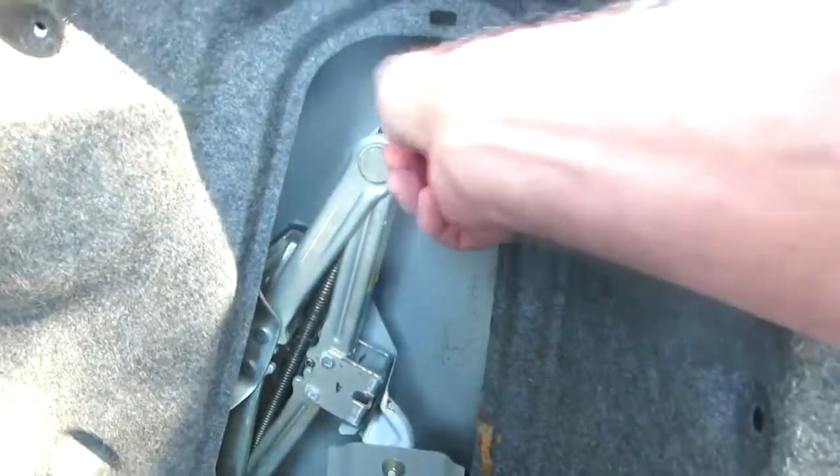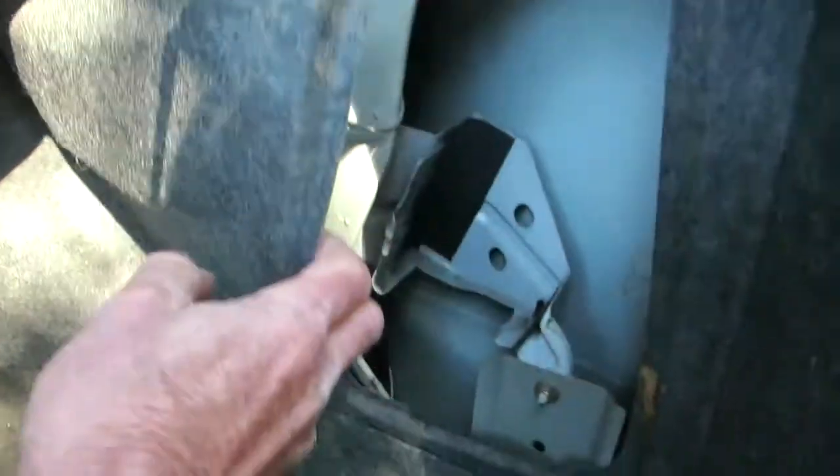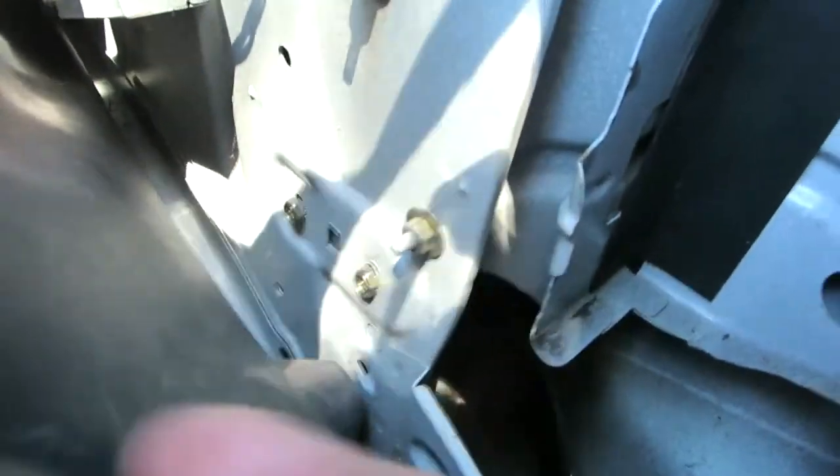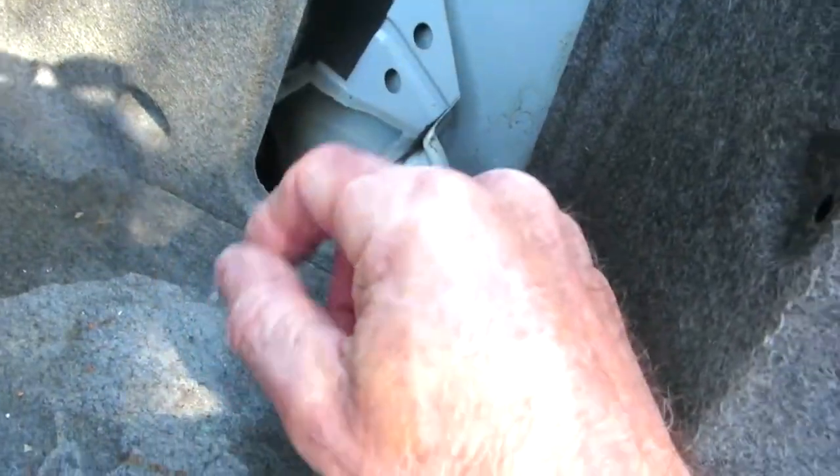You're gonna take this panel out — jack should live in there, wedges itself in there. Pull this panel out, there's a screw up here and a screw down there. There are two 10-millimeter bolts down here which come out once you take that top piece off. At the bottom there's a small tube that goes into a little drain fitting, and another drain tube that comes off the bottom of the antenna.